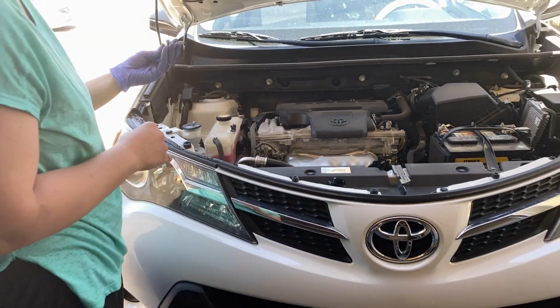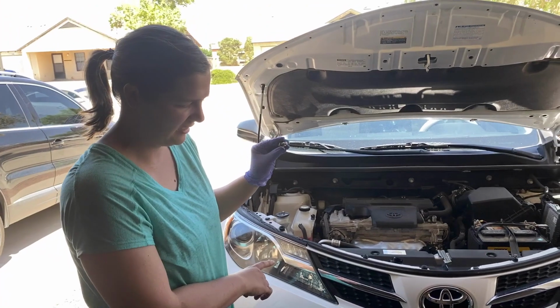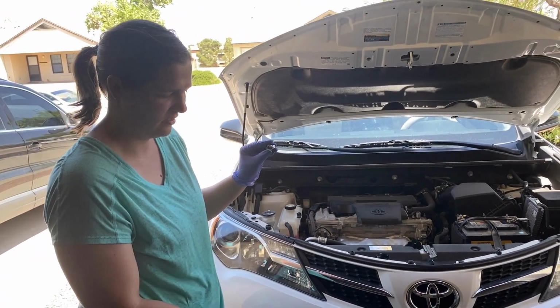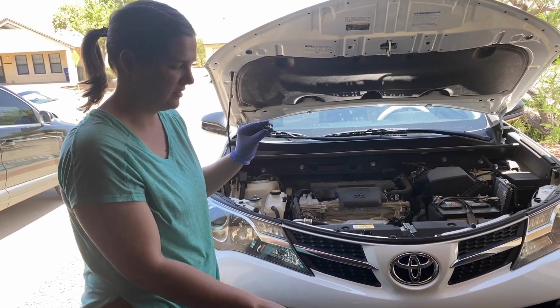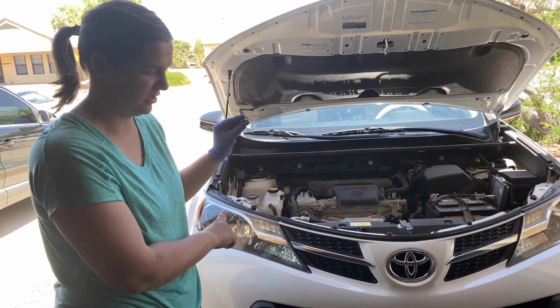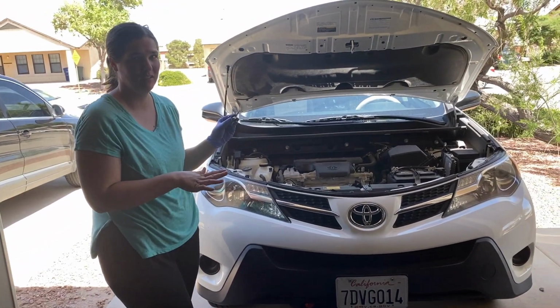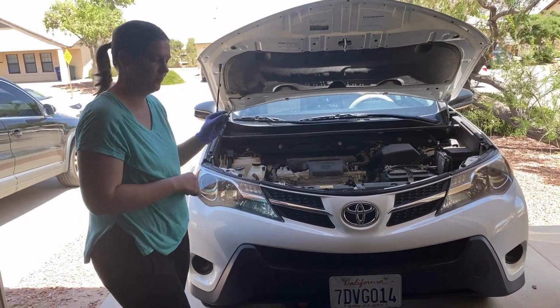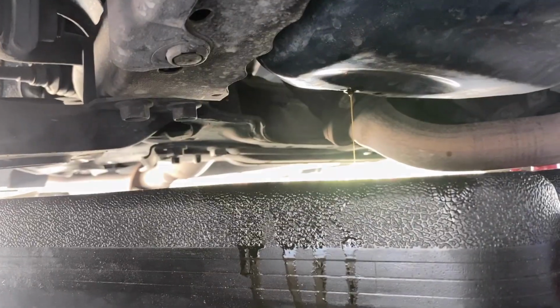Okay. All right, so clean this thing. That's still draining. And then the funnel is for pouring more oil in, right? It's for pouring the oil. And then the other three things down there are for changing the filter. Yeah. And when do I do that? Once the oil's all drained? Yeah, once you've drained the oil and you put the drain plug back, then we go to step 2, draining the filter. Yeah, that's where the filter is gonna go, once you put on the drain plug.